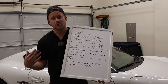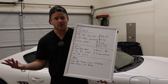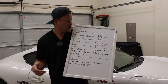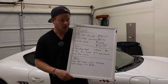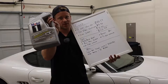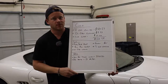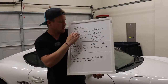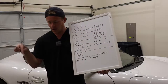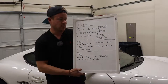Supplies that you're going to need to purchase: you're gonna need seven quarts of zero weight 40 oil. I use the Mobil 1 European Car Formula because that's what Porsche recommends. At the time of this video, that came out to be $40.59 for seven quarts — it was $28.99 for a five-quart jug, and if you get two of those you'll have a little extra leftover for next time.